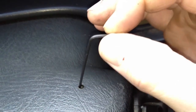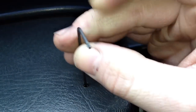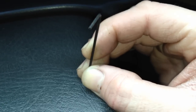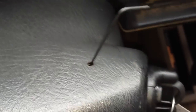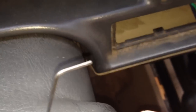You'll feel just like a piece of plastic. If it doesn't go down, you're not finding it — there's an extra hole in the plastic. You'll see when you find the right place; it isn't hard to get at all. It drops down in. All you have to do then is turn the key all the way to the start position, and as you're doing it, you push down on the allen wrench here.